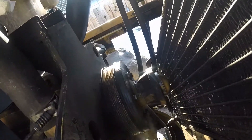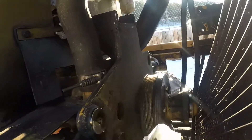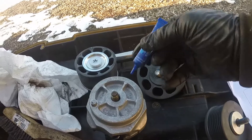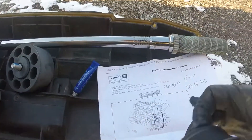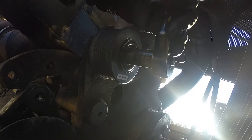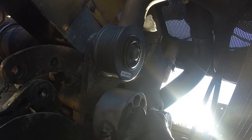Wire-brush the tensioner mount and do the cleanup on all mounting surfaces — make sure there's no dirt or dust. Spray brake cleaner on a paper towel and wipe everything clean. I'm using medium-strength blue Loctite to prevent those bolts from getting loose and to protect the threads. Starting with the small accessories pulley first. Tighten the bolt and I'll torque all three accessories/idler bolts after they're all installed.